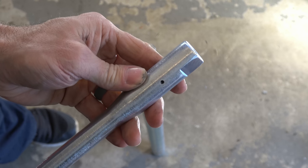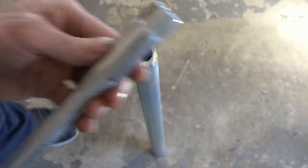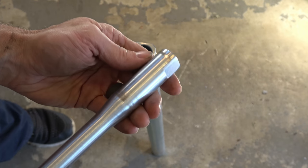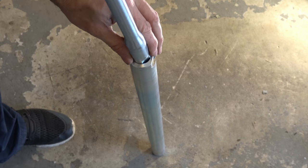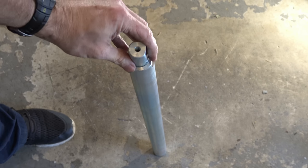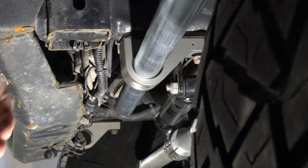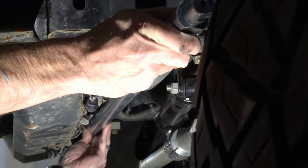Once you have that pretty close, you can go ahead and torque those down to 45 to 55 foot pounds. Don't tighten down the rearward bolts because we need a little bit of rotation there, just to make sure we have a way to get those torsion bars in. You can see here why we have to do this first before we put the bushings in, because you can't get to it after the fact. The smaller diameter torsion bar has a hole on one side and not the other — and that's important to note.